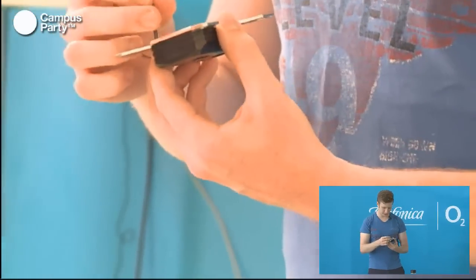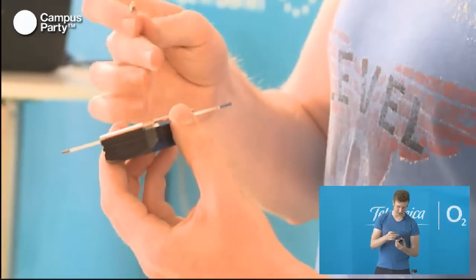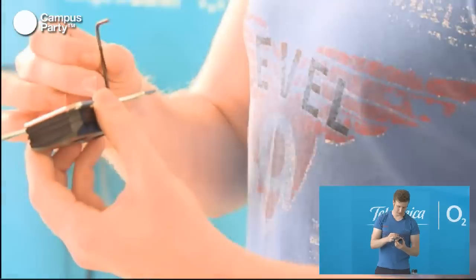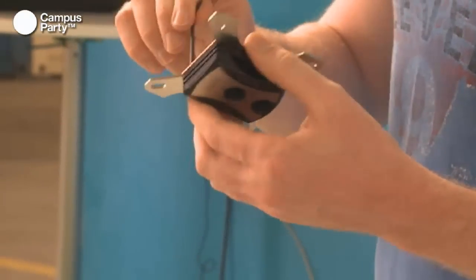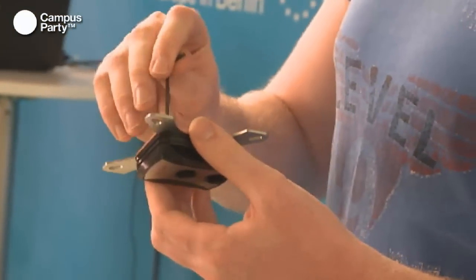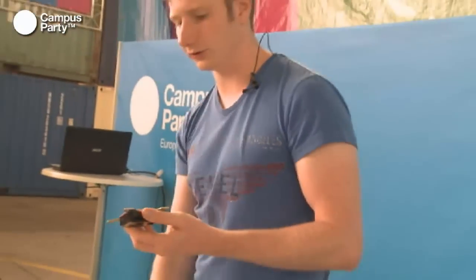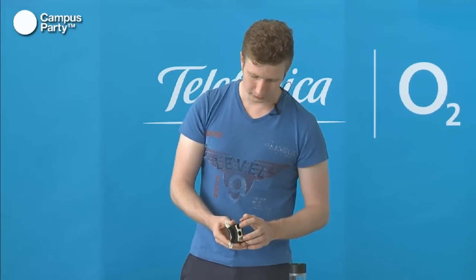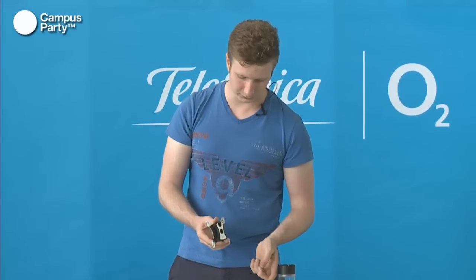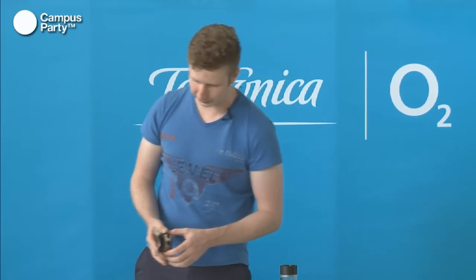In the blocks in the old days, it wasn't important to remember where the intake and the outtake of the block were. But seeing that these blocks have these small channels down in them, you want to remember to have the intake and the outtake placed right. Otherwise, the block won't perform properly and it'll make a lot of noise in the system. So on this block, the intake is the middle hole and the outtake is the top hole. So you want the pump to pump the water in there and then it goes out here. So we'll just mount two fittings on this and make it ready.